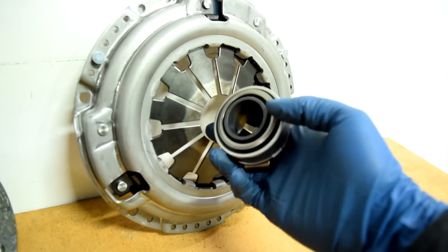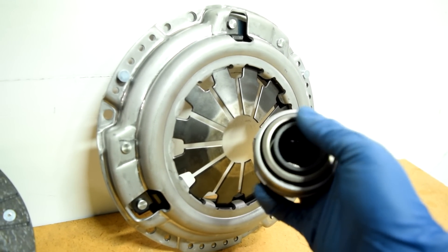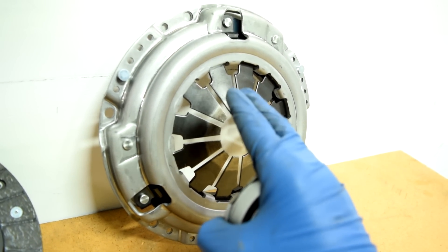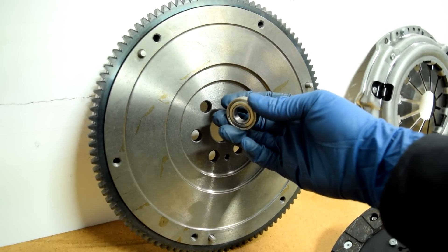As for what could cause a bad bearing noise — like a clicking noise when you apply your clutch pedal — if you hear the noise when you're just starting to apply your clutch pedal, that noise could usually indicate a problem with your release or throwout bearing. But if you hear it all the way at the end where you've depressed your clutch pedal all the way to the floor, that could indicate a problem with your pilot bearing. When you're starting to apply your clutch pedal, the release bearing makes contact with the spinning pressure plate — if you have a bad bearing there, it's going to make noise. But when your clutch pedal is all the way down, that's when your clutch disengages and the outer race and inner race of your pilot bearing start spinning at different speeds — if that's when you hear the noise, that's a problem with your pilot bearing.